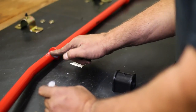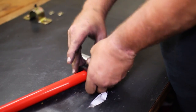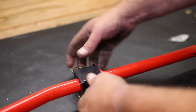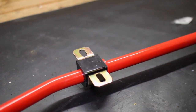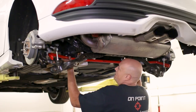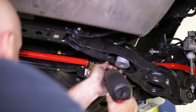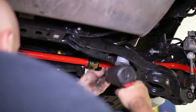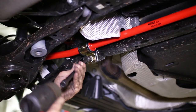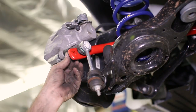Just like up front, grease the sway bar where the bushing attaches to prevent any noise. Then add the new rear brackets to the bushings on the sway bar. Install the sway bar to the car and bolt down the frame brackets first. Attach the end links to the ends of the bar in your selected mount on the new sway bar, then tighten them down to finish up.